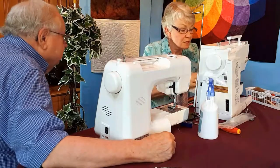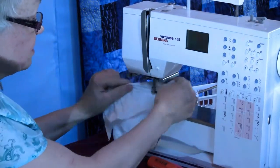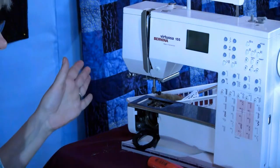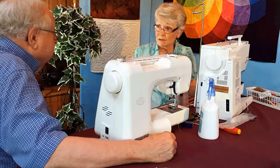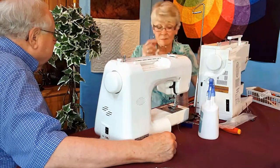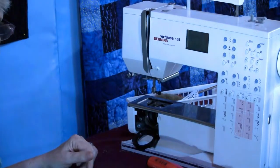All right. While we're looking in this area, we have a row of lint that's building up on the needle bar. I'm always cleaning. This machine will have lint there. All machines get lint right there. I've noticed that. Okay. Yes. And I don't know if it's the thread or the fabric or the batting, but you are using so much cotton. And every time that needle pierces through the cotton, you're pecking away at little fibers. They become airborne. The reason why they're sticking there is there's also a fine film of oil. So it's just a trap for that lint. So clean it off, okay?